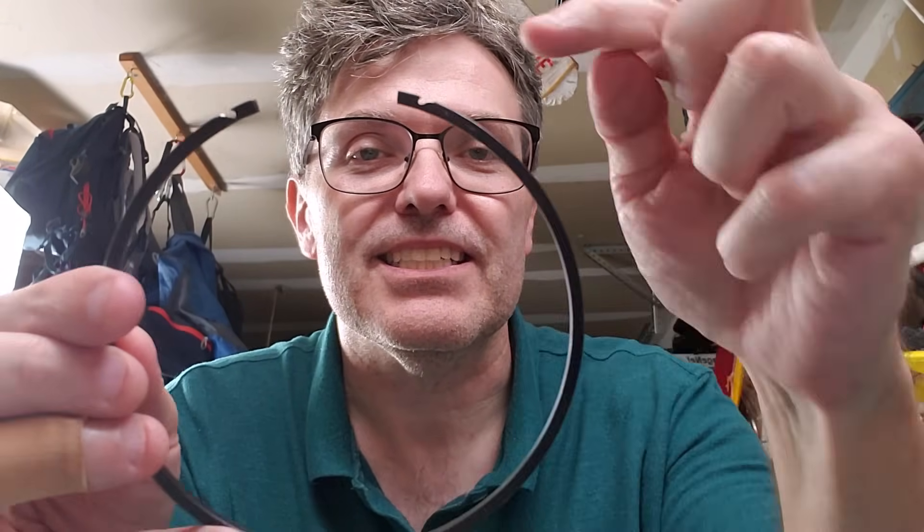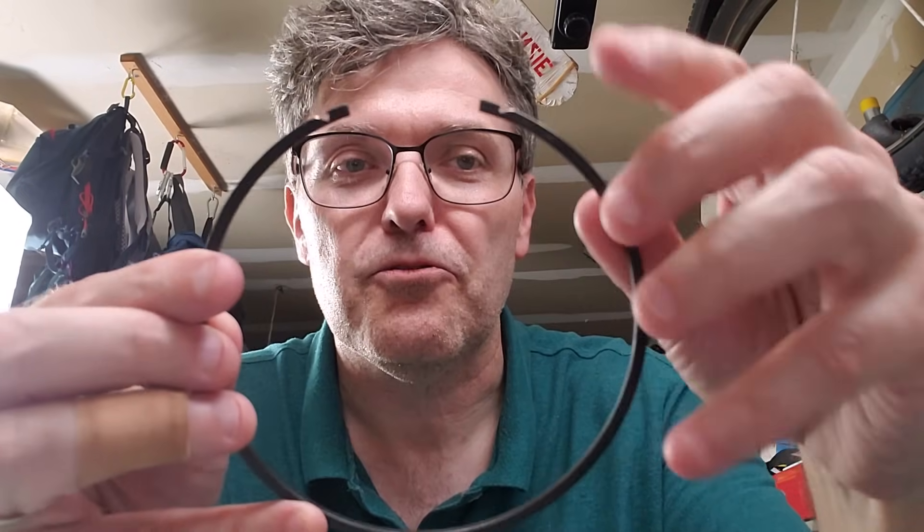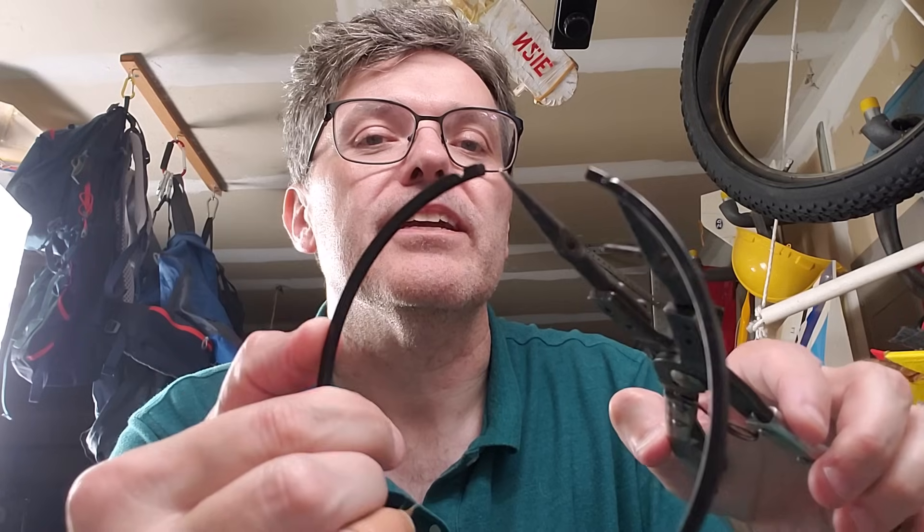What I was able to do was use a cutoff tool and a Dremel and cut basically slots. I didn't go all the way through — I went about halfway through — and then that allows the ends of my spring puller to grab it and pull it together.